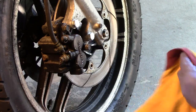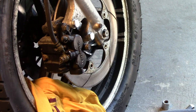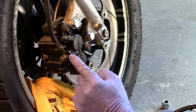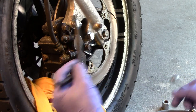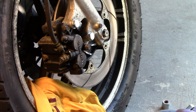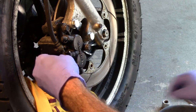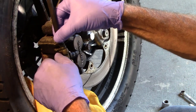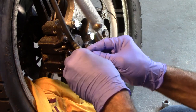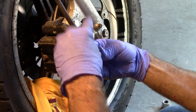I've got some gloves on because I really hate getting brake fluid on my skin. Let's cover up some of this stuff here — brake fluid will remove paint, so we've got to get the brake line off. When it comes off it's going to want to leak out. I've got a little trick for that. It's a 10-millimeter banjo fitting, 10 millimeters inside there. I've got some tubing here that I can cut a piece of and push inside the banjo fitting, and it will stop the flow of the fluid while I'm working. I'm going to lose a little bit here before I can get the piece of hose stuck in there to stop the flow, but at least I can alleviate some of the mess and save a lot of brake fluid and also some bleeding later. So if you get the right size piece of hose, it should just fit in there nice and tight.